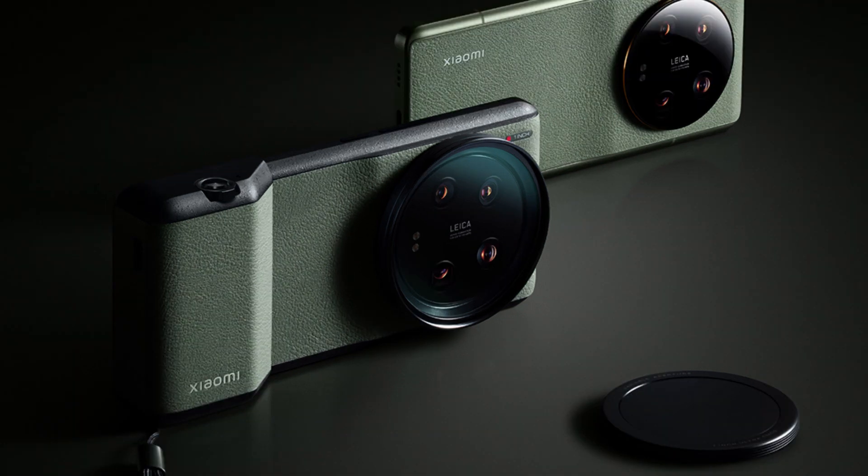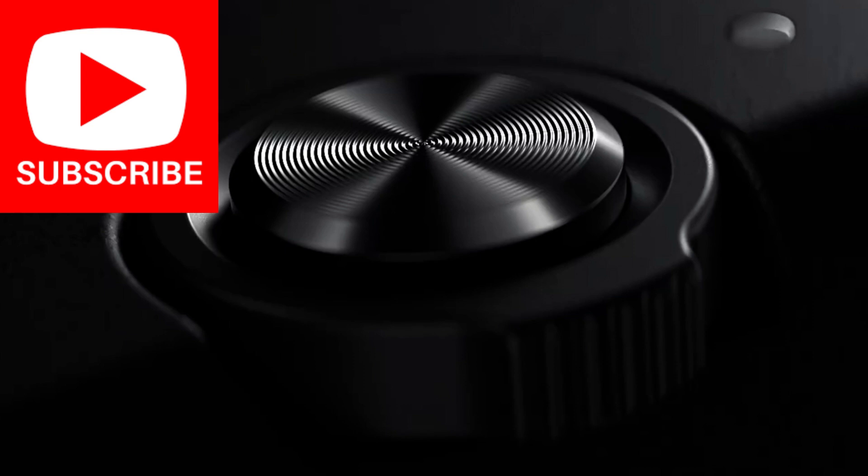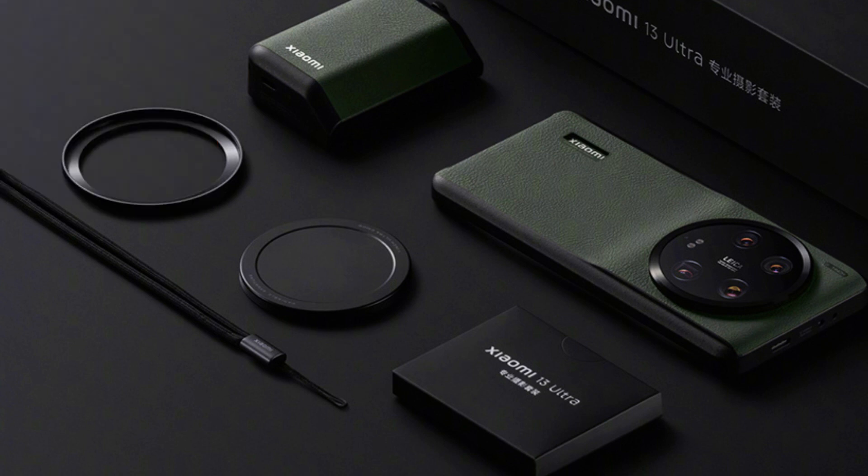For a DSLR, a mechanical 12-blade iris gives you a variable aperture that you can adjust to whatever exacting degree you want — something like f1.4 to f22, and any microscopic step in between. These two-blade irises only have two states: the open f1.9 mode with the blades retracted and out of the way, and the closed f4.0 mode with the blades extended to form a smaller circle. Just like on the Samsung phone, the physics don't entirely work here, so we wouldn't expect much actual benefit from the hardware. We're sure there will be plenty of software depth of field effects, though.